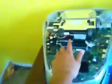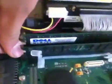Okay, now you can see here that we've entered the inside of the iMac. Here we have our logic board. You have two sockets for 168-pin RAM — SD RAM. You have your hard drive here, and then under the hard drive you have your CD drive. Now, some of you may or may not know how to take off the RAM and the hard drive and everything, but I'll show you. For the RAM, all you gotta do — there'll be a little latch here and another latch on the opposite side directly across it — and that's how you take off your RAM.